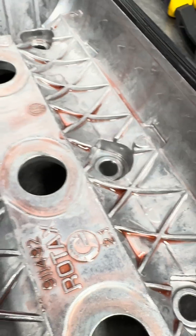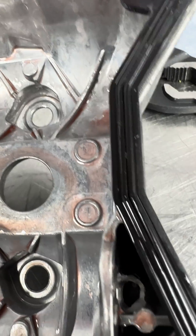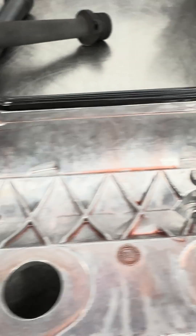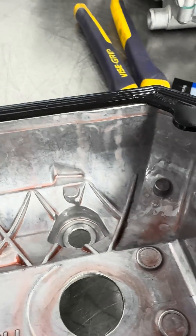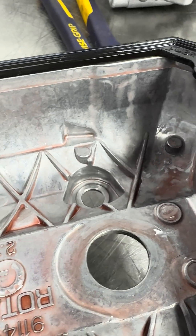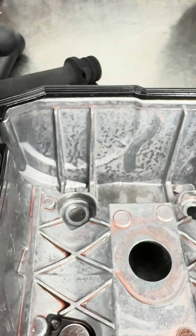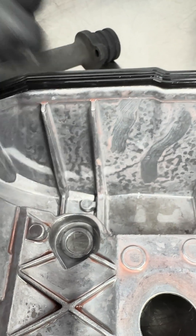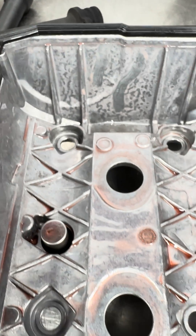That's five minutes of running, and we have a sort of jerry-modified rig here where it's been venting differently. This is super early test stuff, but you can see the water in there. After a couple more minutes, depending on the health of the motor — and this is a brand new engine that's never been driven, we've only dynoed it — this gets worse.